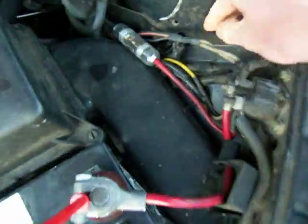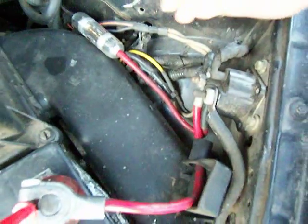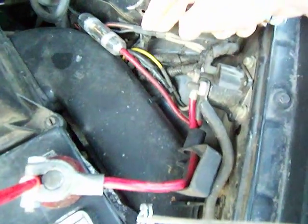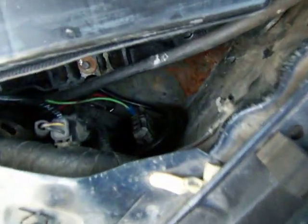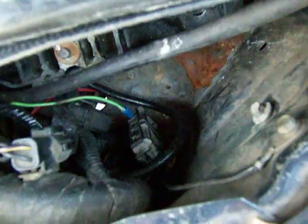If the indicator light does not turn on, you've either got a bad indicator light or a burned-out bulb on your dash, or there's a problem with the circuitry like the wiring. You could have a fusible link blown out, in which case you'd do a continuity check — or, as in my case, I had that green wire hooked into the wrong terminal of the factory wiring harness.